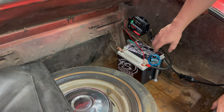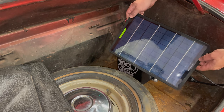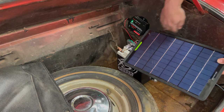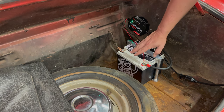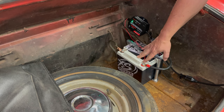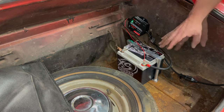I went back and looked at the camera — it took 43 minutes to charge this up with a 1.5 amp charger. You can imagine how a small solar panel like this that provides only 0.75 amps would actually make a lot of sense. This solar panel charges only half as much as this battery charger, but neither of them really charge very quickly. However, they work very well with an ultra capacitor like this. If you were driving your car regularly or you had a solar panel attached, your ultra capacitor would never be drained as much as this one was. So you can imagine how an hour a day of solar charging on an ultra capacitor would keep it good all the time.